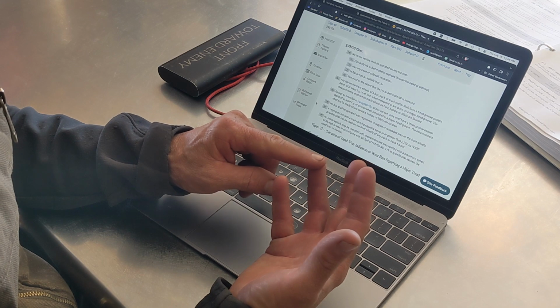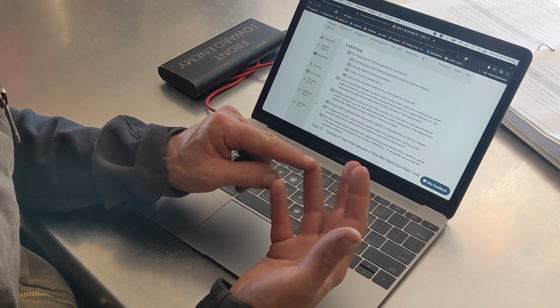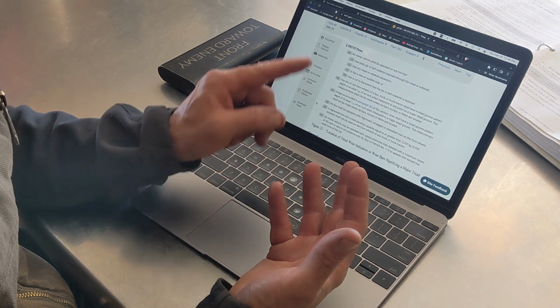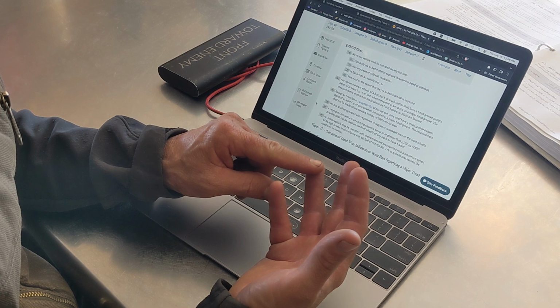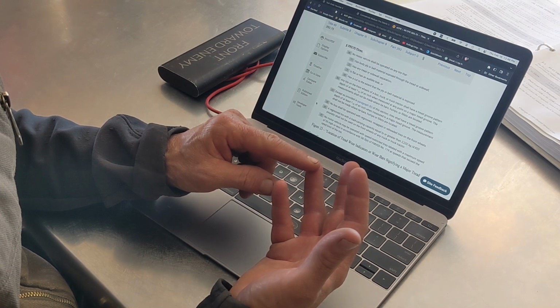The other is environmental impact. If you use a tire that still has a good casing, and many of these retreads are used on casings that are 10 up to 15 years old maybe, they're inspected, and again, you'll see that they're no more likely to fail. They're just as safe as a virgin tire. But the environmental impact by not putting that usable casing in a landfill is attractive to a lot of people. If you want to throw away a perfectly good casing, how dare you?